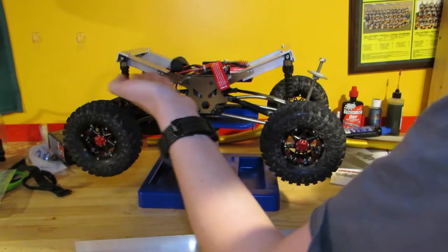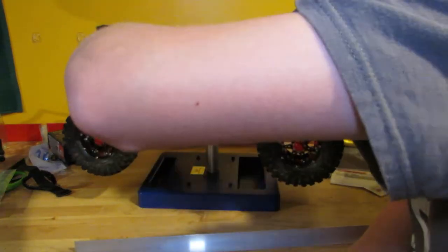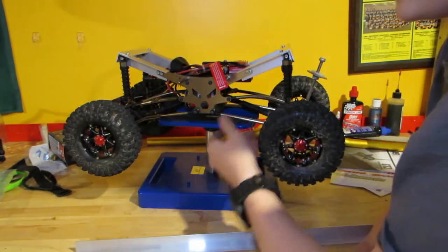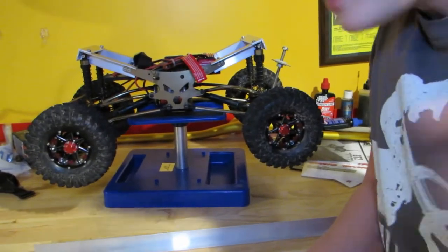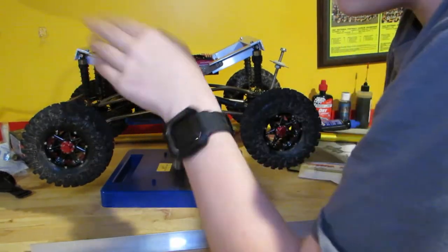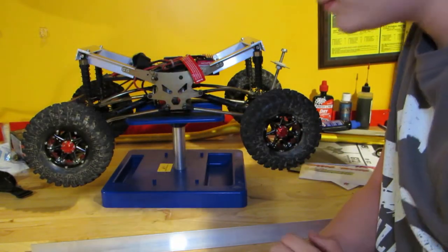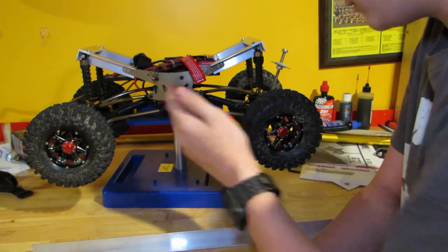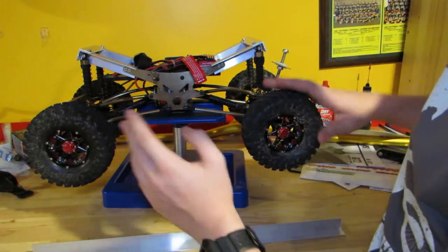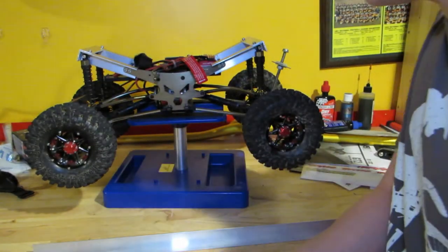As you can see, these go straight up — they're not completely vertical, but they're still facing forward. The reason for that is, if I were to put this horizontal like this, it would lift the truck by like an inch. I would be completely okay with that, but this is a tow vehicle for me, and that would mess up the angles of the axles, the driveshafts, and then the hitch, and it would just be a headache to redo all that stuff.